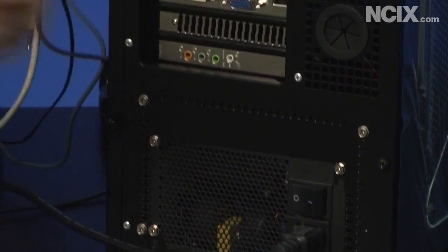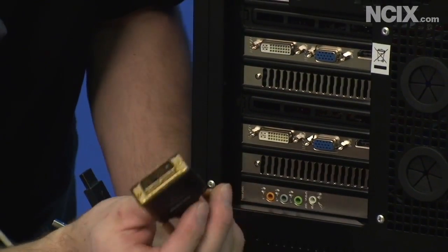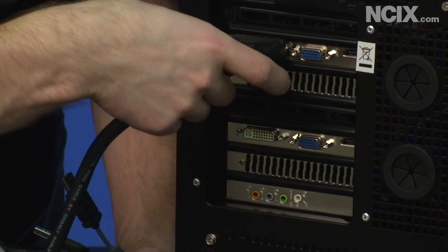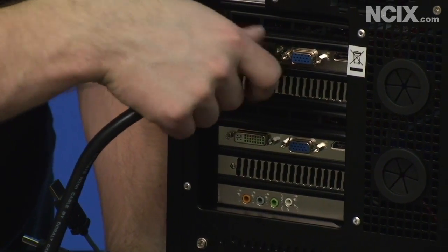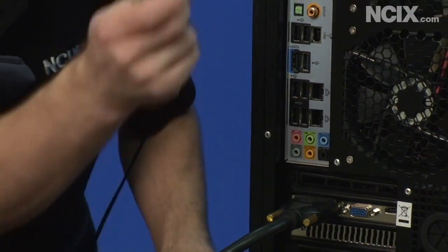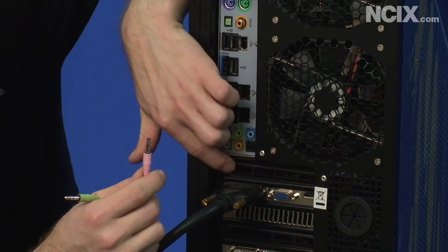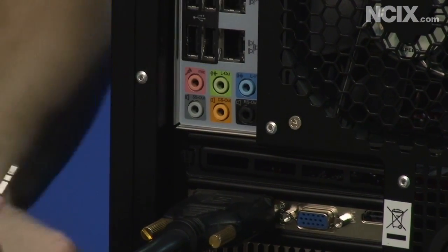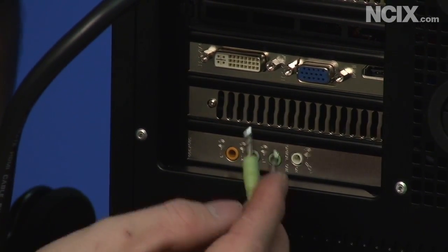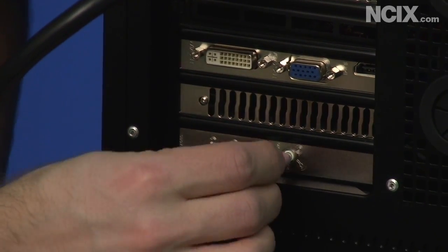The next thing you're going to want to plug in is your display cable. We're going to be using DVI, but you can see with these graphics cards we could plug in HDMI, VGA, or DVI. With an SLI configuration, I normally use the top card, although there's no logical reason — you could plug your DVI connection into either of the DVI connectors and it would work fine. Next we're going to plug in audio. Using a headset with speakers and a mic, the green one is for speakers and the pink one is for the mic. There are actually two sets of audio ports on the back because this computer has an add-in sound card — the color coding isn't exactly right, so the green goes to the green, but the mic plug goes into the port with the little mic icon next to the white one.